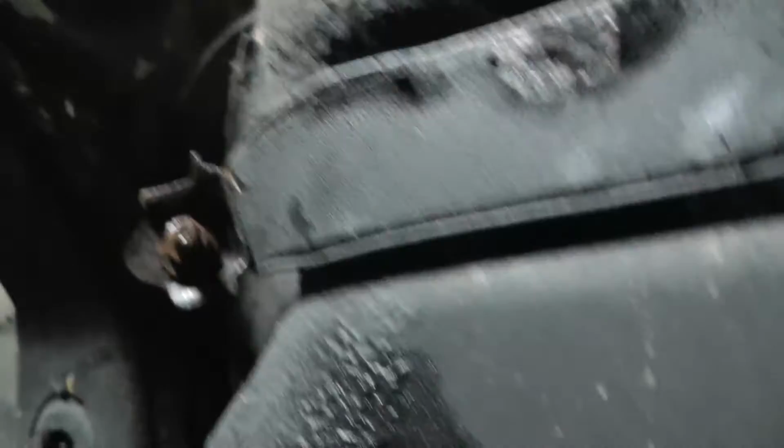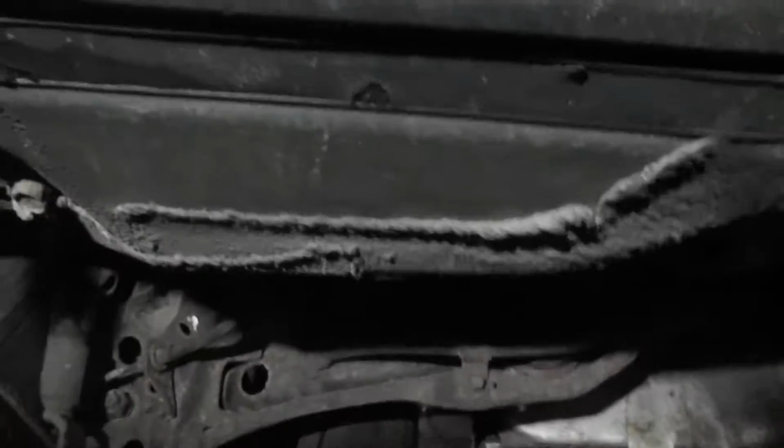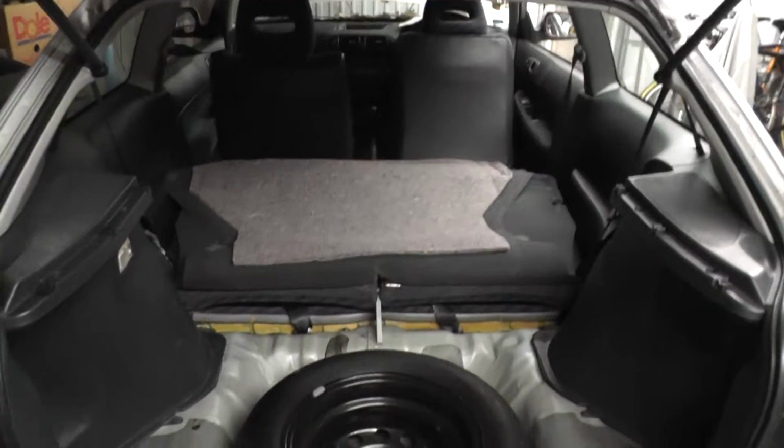So you saw before I was spraying these bolts up, and it's got these other bits of the strap, which at the front, these 14 mils, which you can just about see there. So what I need to do is go inside the car, take out the back seat, pop off the cover, and just take off all the connections and look to be dropping this tank down. Just pop the boot open,